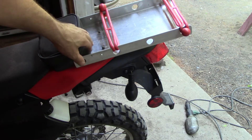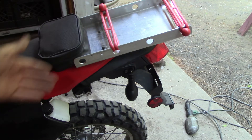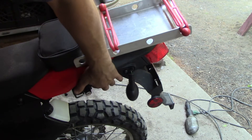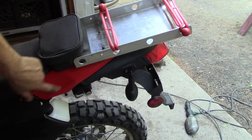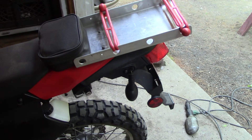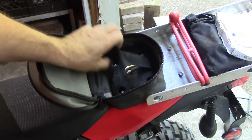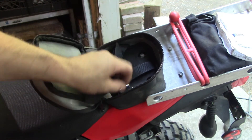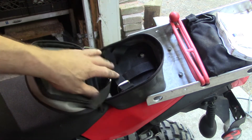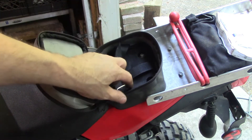I put this rack on here so I have to get the rack off first. I'm thinking I've got to take the rear fender off too - there's no wires under here you can get to. There's a harness right around here that pokes out but it's wrapped in a loom. I'm going to start by taking the tour pouch out - there's four stock bolts here that hold this bag on. Let me get them off, get this rack off, and see what we're looking at.